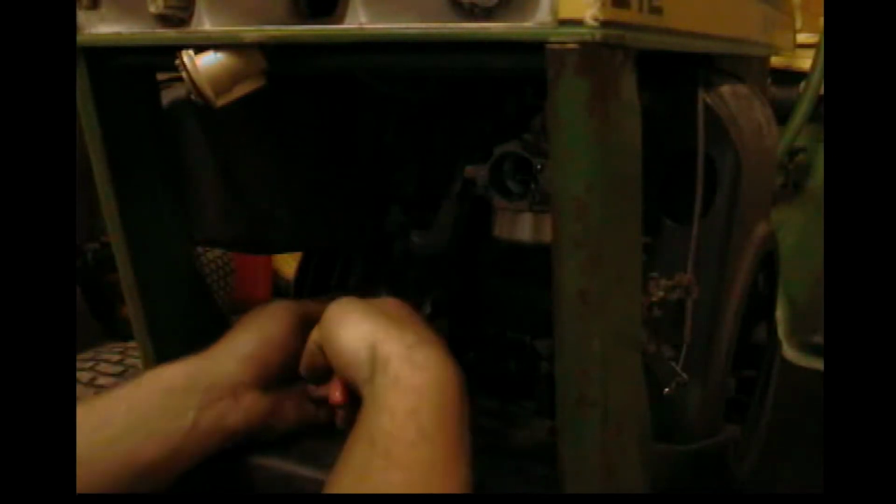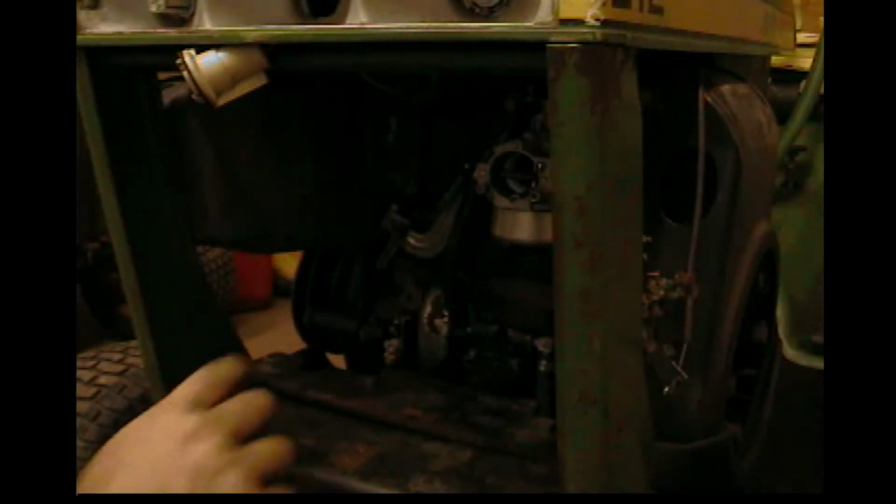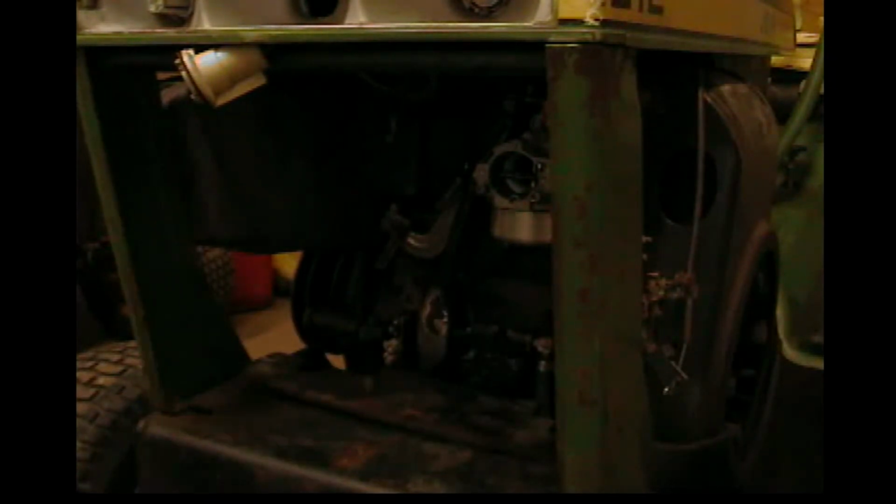What we could do, it's probably not recommended to do this, but I'm gonna put the throttle back up and throttle the engine with the governor with this hooked up. Maybe that'll help me. So let me run this to where it needs to be. No. I would like to get this out of here. I want it in this notch. There we go. Third notch from the bottom. There's two right here, then there's more up here. Third notch from the bottom is where you want it.